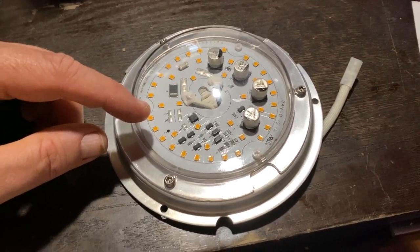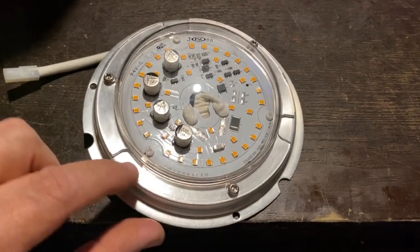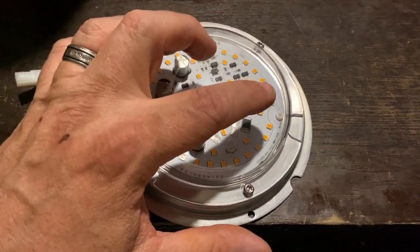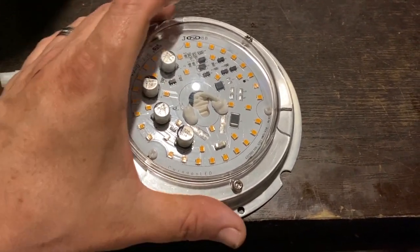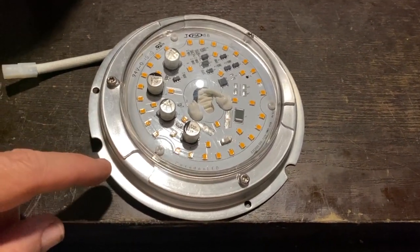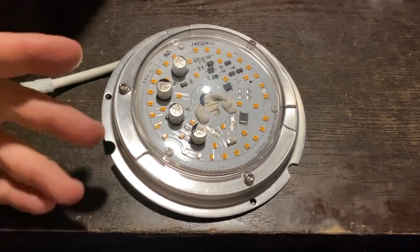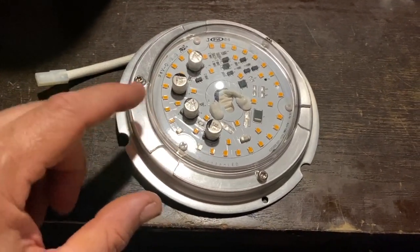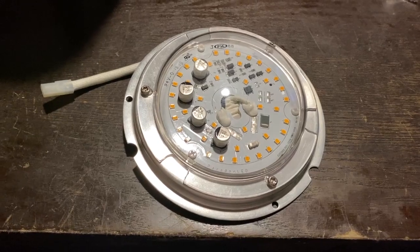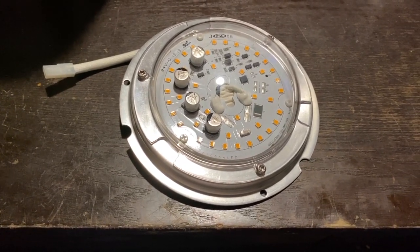If you want to secure the engine board onto the plate and the holes don't match up — some have four holes, some have three — you can drill another hole to match them up. One important thing: measure the size of the engine to make sure you get a new one that matches the plate. The ones from Amazon come on their own plate with their own dome, so take it off and put it on your original plate so it mounts without issues. Then use the connector from the old one and attach it to the new one so the connector will match.